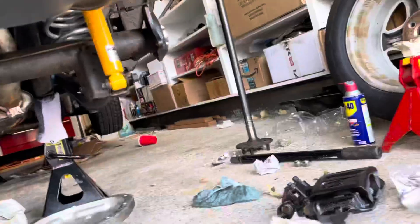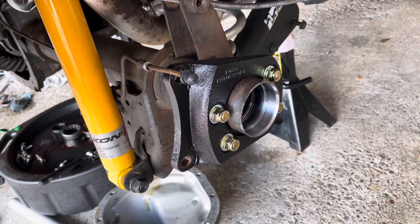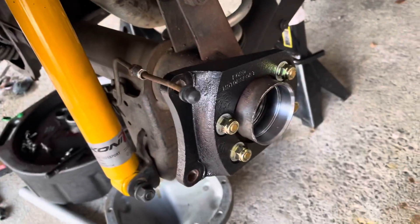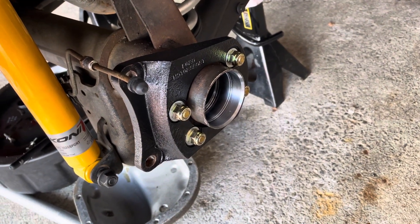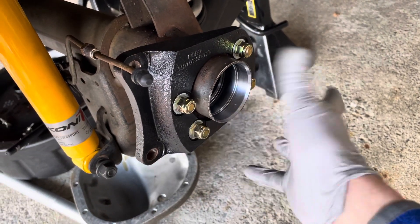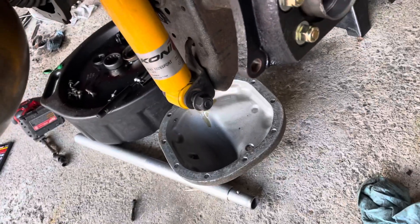By the way, you're going to take your brakes apart before that. The reason I'm doing this whole thing is because I was doing a rear disc brake conversion using an old-school Ford Motorsports setup. I went to take the passenger side wheel off and found a big mess of gear oil all over the inside of the wheel. The drum was here — if you pull the drum off, you might have to tap it with a hammer if it's been on for a long time. Then you'll see the exposure and the back bracket for the drum, which you just leave there.